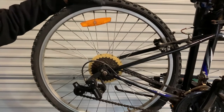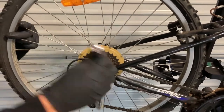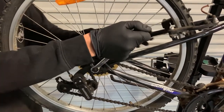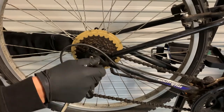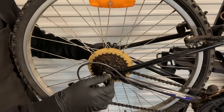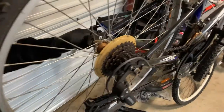Now it's time to dismount the wheel. With standard bolt axles, we bring out our 15mm spanner and start unscrewing the nut left ways — left to loosey. If you have the quick release skewer, all you need to do is lift the quick release and unscrew the skewer. If you're having trouble, go find some WD-40 and just spray it down — not too much that it gets messy. Unscrew both sides enough for your fingers to take over. Once both sides are finger tight, get ready to pull the tyre out. You unscrew both nuts enough for the wheel to come out on both ends, and then the wheel should slide right off when you give it a small bump.